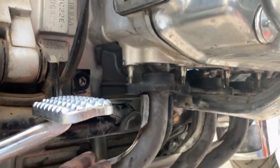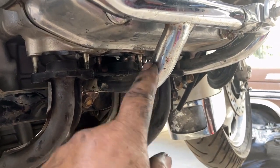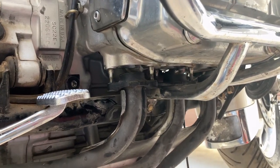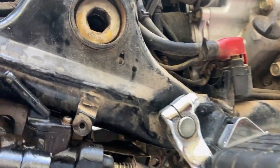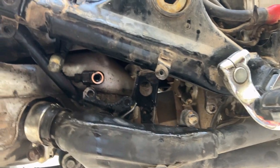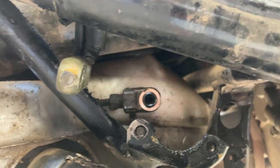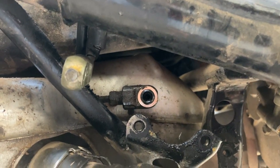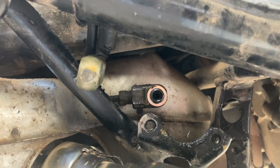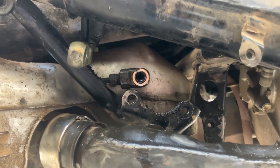We just had to loosen the exhaust and pull it down. We didn't really have to remove the bracket — at least I hope not — just enough to drop that exhaust pipe down where we could get back in there with a wrench. Then of course the cylinder comes right out of there once you get that. Now that line there is a bugger to get to, so we want to make sure we get that nice and tight when we put the new one in so it doesn't leak, because we won't be able to get to it.